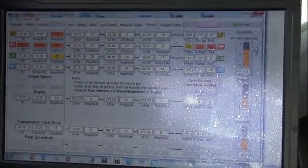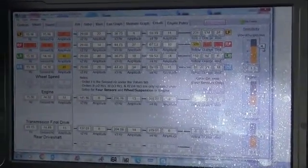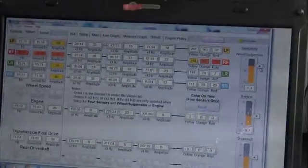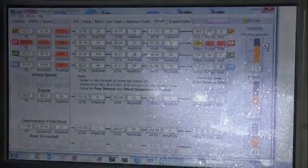You got to have multiple sensors on the car in order to know where it's coming from. Otherwise, it's just everything vibrates. It's hard to know where it's coming from. Okay guys, we can clearly see that we've got a vibration on this car. We need to go back to the shop and move the sensors around so we can isolate exactly what's vibrating now.